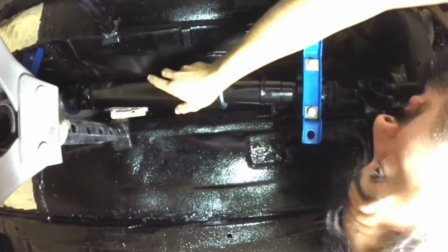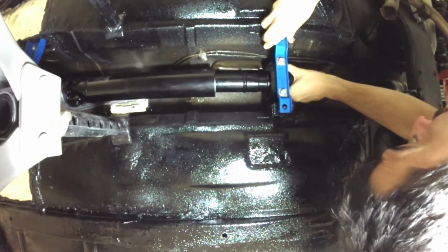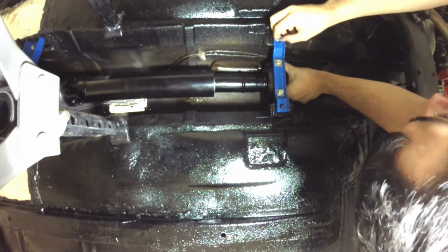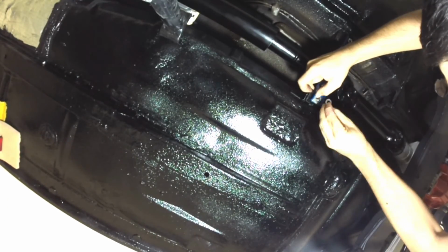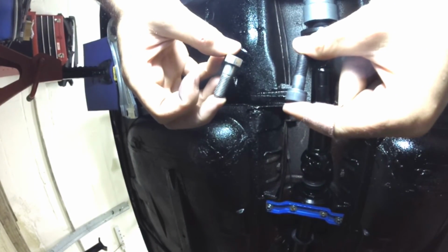Once everything was done, the supporting brackets have been installed and the prop shaft flanges are aligned to each respective end. Also, the flange bolts were replaced with a higher grade of tensile bolts. These bolts were upgraded from a 10.9 tensile to a 12.9 tensile strength.